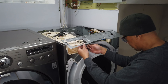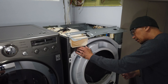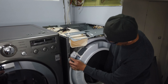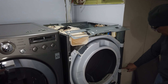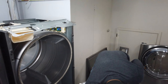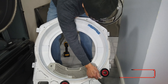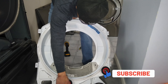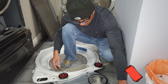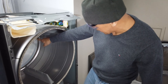Secure this harness here so that when you pull this, it's not going to damage the wire. There's a guide here — four guides here that you need to lift up before you pull it out. These are the drum rollers that cause the noise. We are going to replace these with this new drum roller. But first, let's check the drum roller at the back here.